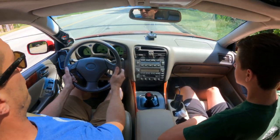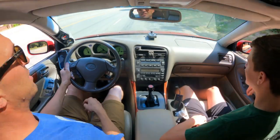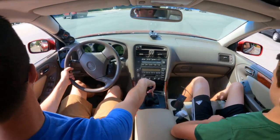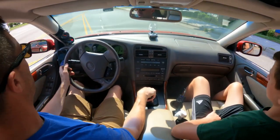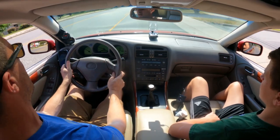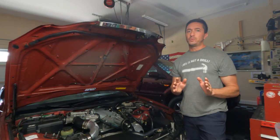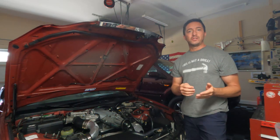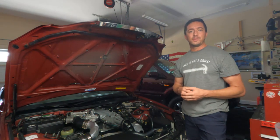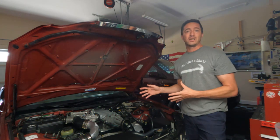I'll do a second gear pull from 3,000 RPM but I'm going to back off. Watch — it hit 13, that's not good. I've got the needle maxed out at 25 psi from 2,000 to redline. I think the stock injectors are not up to the task because I'm in the 12s on my AFR — you really want to be 11 to 11.5. Running a little too lean for comfort, so I've ordered 330cc injectors and they should be here in time for Episode 4, where I'm going to talk about tuning these things properly. Thank you for joining me on Episode 3 — if you're not a subscriber, hit that subscribe button. I look forward to seeing you on Episode 4 when we get this thing all tuned up.